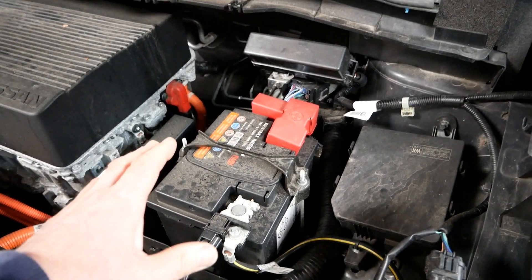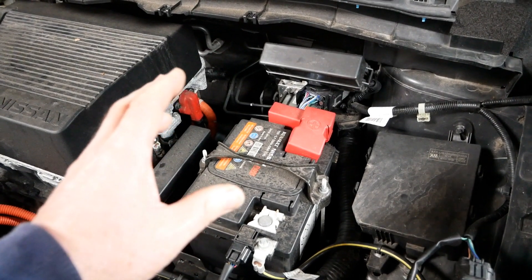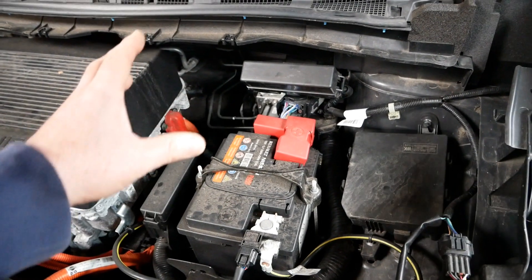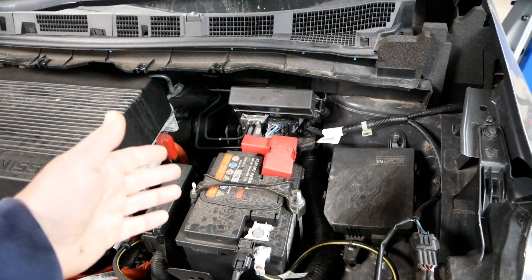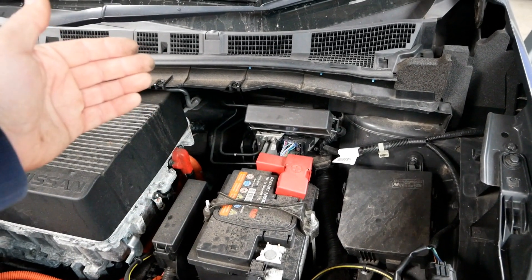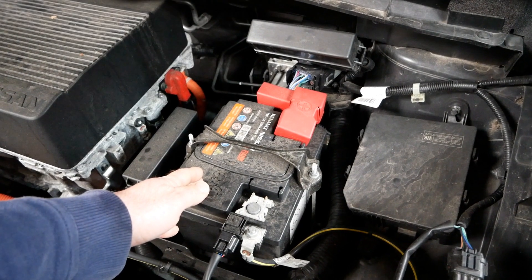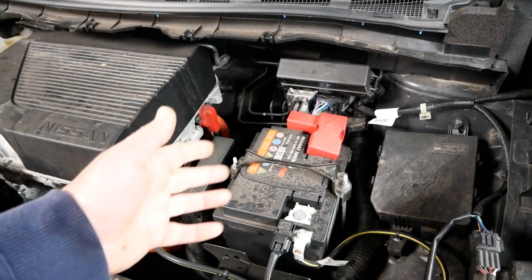This is the 12 volt battery. All electric vehicles have a 12 volt battery, and many question the purpose of it, but in reality it's just the same as a petrol or diesel vehicle. In a petrol or diesel vehicle that 12 volt battery is turning over the engine to start it. In an electric vehicle it's effectively doing the same job — not turning over an engine, but starting the vehicle. When you blip your central locking and unlock the vehicle, that's all being powered by the 12 volt battery. When you push the button to start the vehicle, the 12 volt battery provides power to the contactors to switch on the power from the 400 volt traction battery. So electric vehicles are completely reliant on a 12 volt battery to start them up, just like all other cars — if this goes dead, the car won't start.